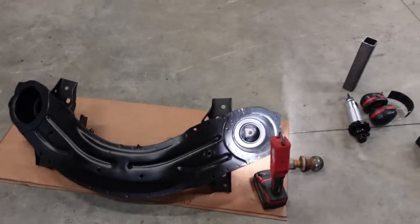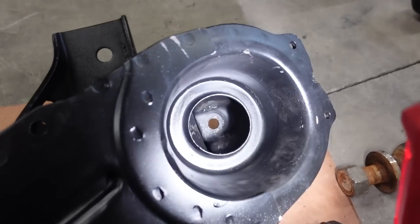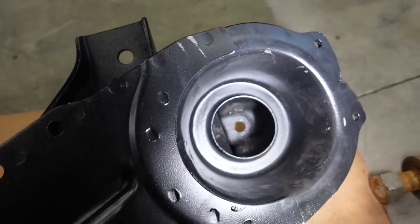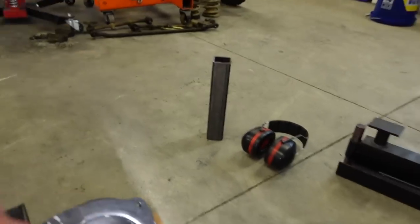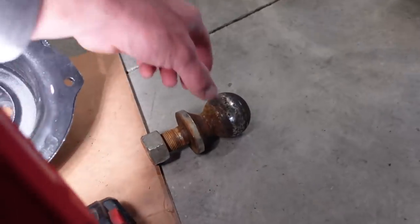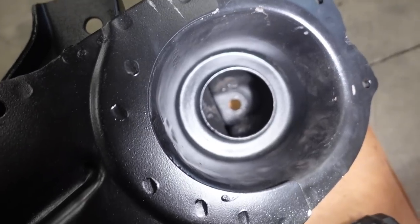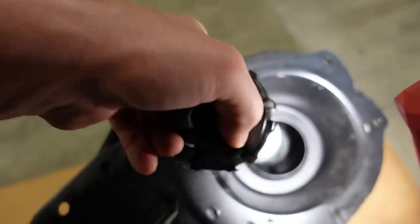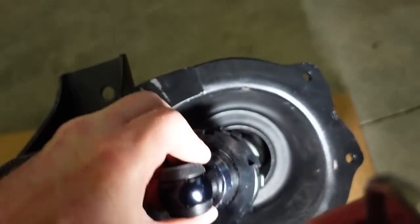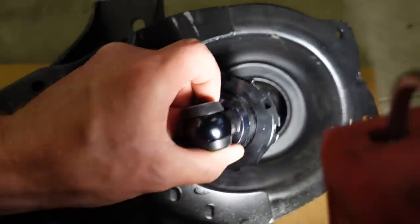Guys, check this out. So like I said previously, this coilover body was hitting the shock tower kind of deal up here, the actual cross member, and I've been trying to find a clever way. I tried some square tube, I tried some pipe, and actually put a bead on the bottom just to get it a little bigger. Nothing was working that great until I grabbed myself a 2 5/16 ball and I stuck everything in my press and I just pressed that ball into the cross member here, and it opened it up just nice and easy. I got probably, I don't know, 1/4 inch of gap on both sides of that shock,